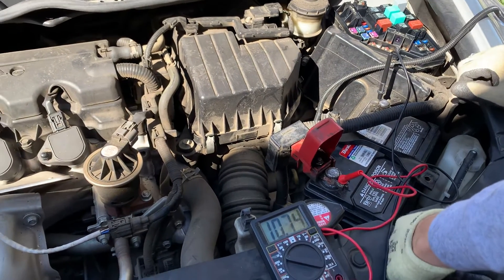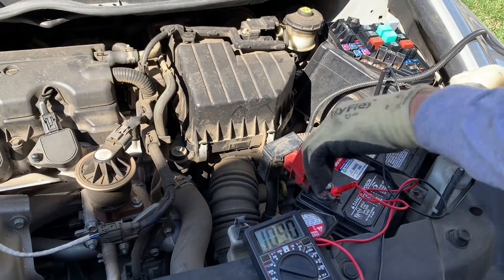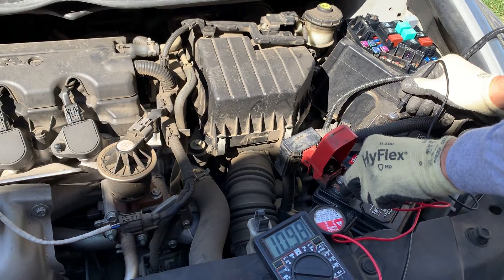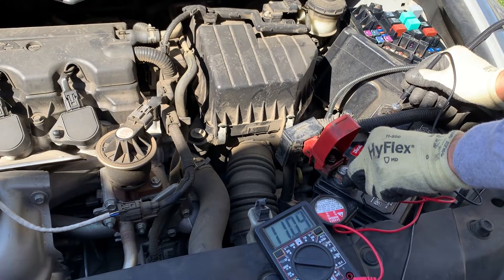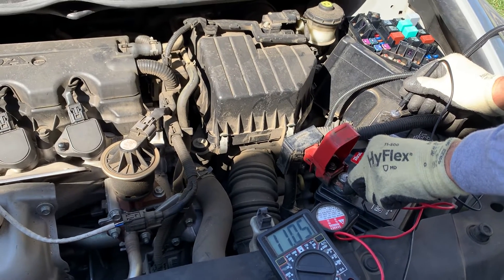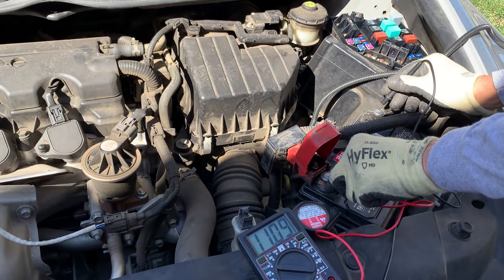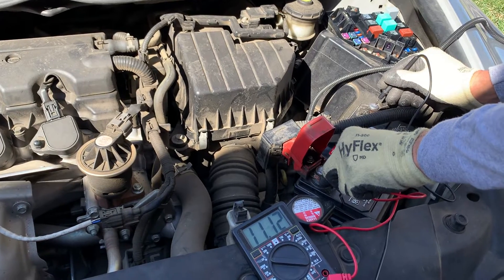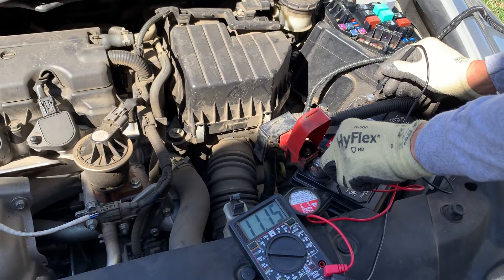So now I know it's not the battery for sure. Now the car is off and it's still below 12.6 — that's because some of the charge was taken from the car while it was running and not charging it, so now it's kind of low, below 12.6. Probably not enough to start it.